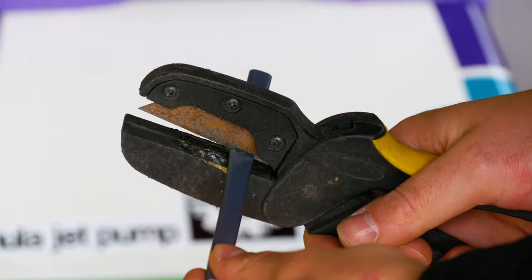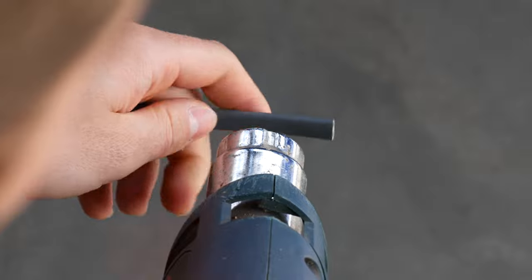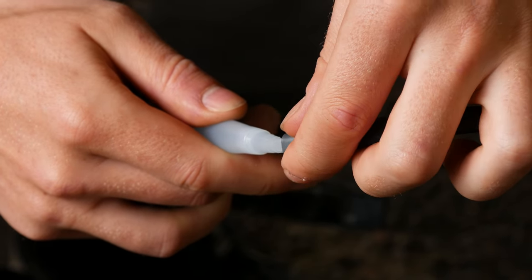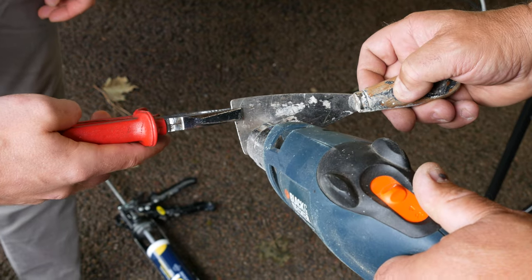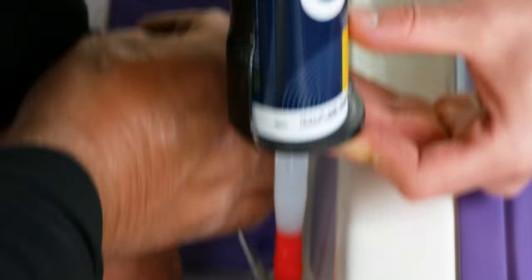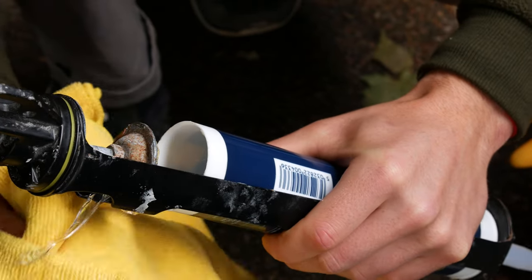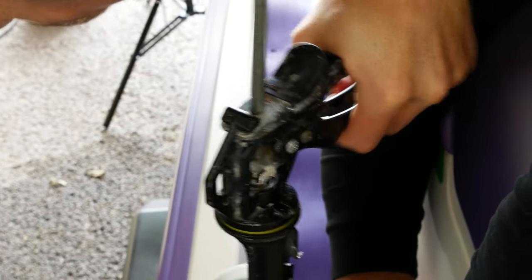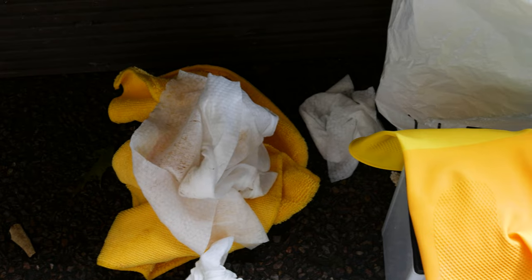So at this stage it was a bit of a head-scratching moment. Then luckily my dad turned up at just the right time and said it's your flow rate. He gave me the great suggestion of getting some electrical cable, stripping out the internals, using a heat gun, warming it up so it was more malleable - it then fit over the end of the actual applicator and helped increase the flow rate. He also came up with a great idea of fashioning a lever from a metal scraper, bent into position at a 90 degree angle to prise under the footwell, giving me the clearance to push the rubber applicator under the footwell and pump the adhesive with less pressure. Even with this improved flow rate, the seal on the back of the tube of the adhesive was giving in before we could pump in as much adhesive as we needed. So it wasn't an exact science - it was improving, but we were getting into a bit of a mess and the process was just trial and error.